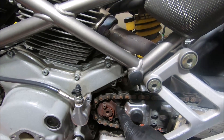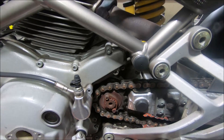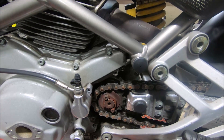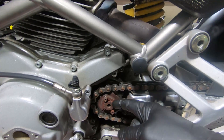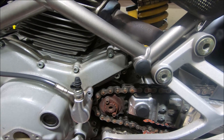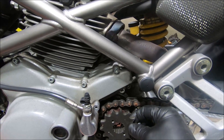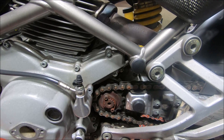That's why they have this offset sprocket with the teeth five millimeters off the face. The problem is they discontinued this sprocket years ago and Ducati superseded it back to the standard one, so you either have the sprocket out five millimeters or in five millimeters from where it should be. What I usually do is use old lock plates without teeth — ones I pull off that don't have teeth left, or just grind the teeth out — and that way you can push the sprocket in far enough that it lines up, which fixes the problem.